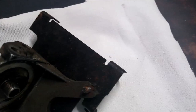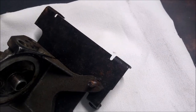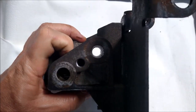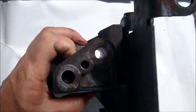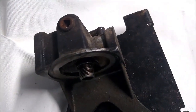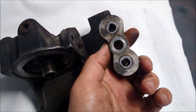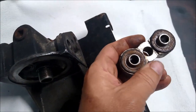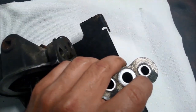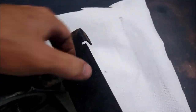Anyways, so this has a line that went into the oil filter. It came out, and I think this one line, yeah, that top line right there goes straight through. That went through to an oil cooler. I don't really think that I'll need that on an old engine like that Flathead 6. So what I'm going to do is I've cut the lines off of this block. It's made like an AC block. And I'm going to tap one side of it with probably an eighth inch NPT and put a pipe plug in it, and that'll block that straight line.